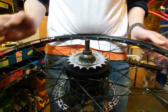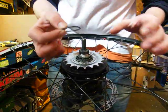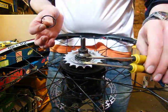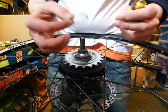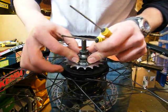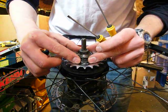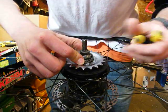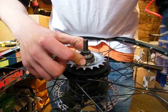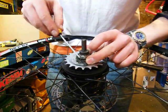Then it's the next bit which is the bit that everyone dreads — the snap ring of doom. They're actually not that difficult to fit provided you've got the right tools. A couple of small flat bladed screwdrivers and a little coating of grease helps. Rather than putting it onto that first step, come down at a slight angle and hook one end in. Sometimes holding it in with the first screwdriver can help, though I often just do it with a finger.